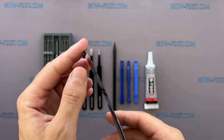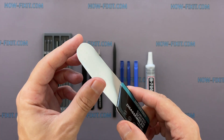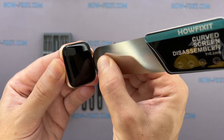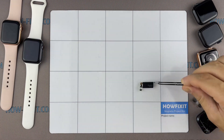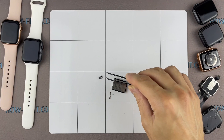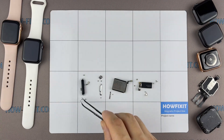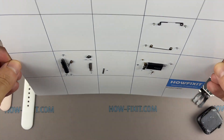This tool has a very thin curved metal blade for opening electronic devices with a screen that is difficult to pry with a common plastic tool. I think this is a must-have tool for disassembling all Apple Watch series, because the gap between the screen and the watch body is so thin. I recommend using a magnetic mat during the repair process, which is especially useful in the case of the Apple Watch. Throughout this disassembly, keep track of each screw and part so you can put them back in the right places. This will help successfully reassemble your Apple Watch, and don't worry about losing any screws and small parts — all of them will definitely remain on the magnetic mat.